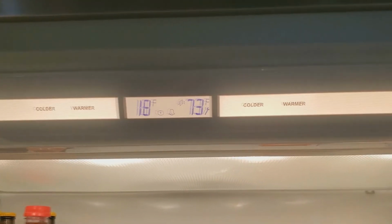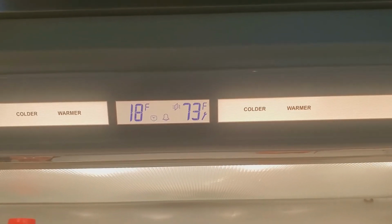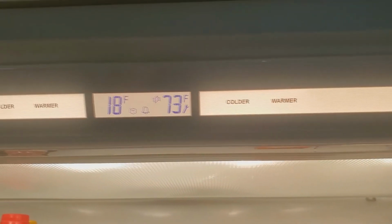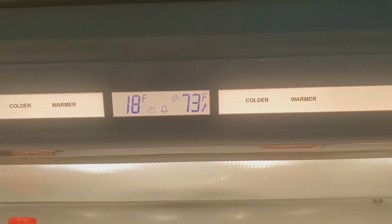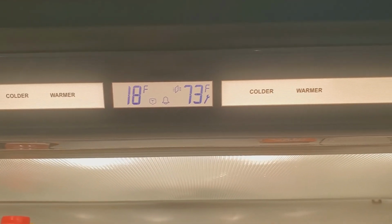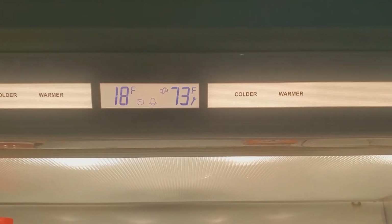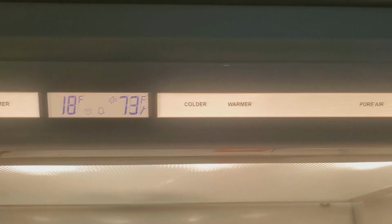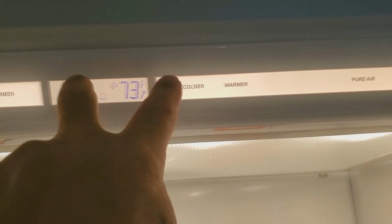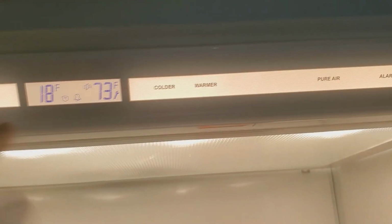Okay, what you're going to do when you program this, what the instructions don't tell you, is that when you first power this on, you're going to see DEFL come up, which is going to make you want to go to that step. Don't do that. It's a default thing that comes up. It's going to change from that to a couple other things. Then you might see OFF on there, separated. It looks like an O and two F's over here. That means the unit's powered off.